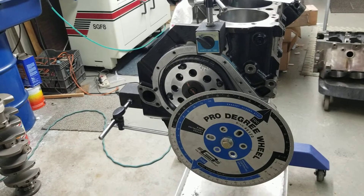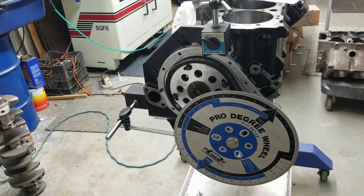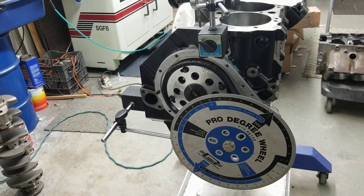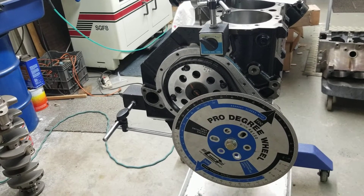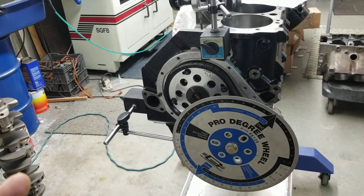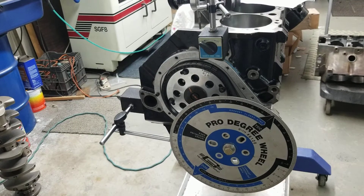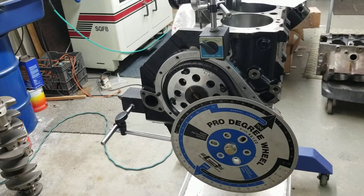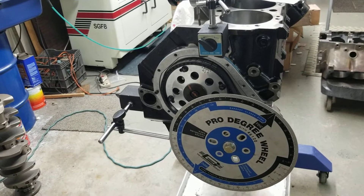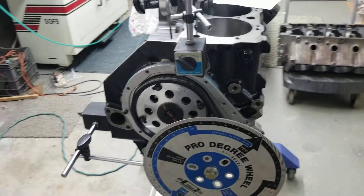It's extremely important to degree a camshaft in — extremely. If you want the best performance out of it, assuming you're hooked up with somebody knowledgeable enough to choose or plot out the intake and exhaust lobes accordingly for the size of your engine — the cubic inches, the static compression ratio, the fuel type you're using — that in itself will yield you the correct cylinder pressure if the intake profile is correct. The exhaust profile we'll talk about on a different time because it gets very elaborate and intricate as far as camshaft design.